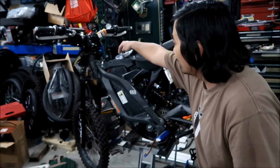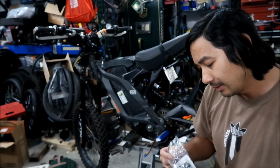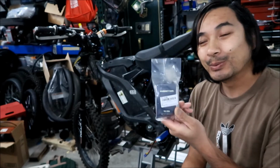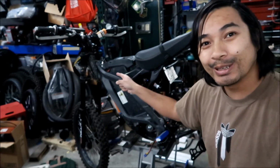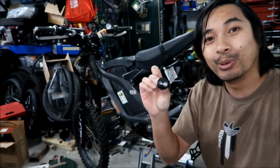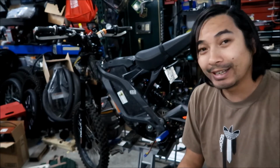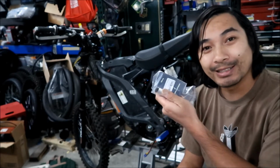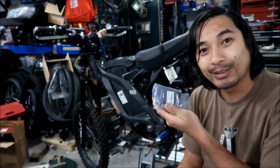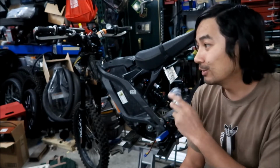I've got a couple of things to help me install this new fork. This is a star nut installer tool. When I installed this fork on this bike, I used a hammer and a bolt to put it in, and I bent one of the bolts putting it in. So I got a proper tool this time. I got it off of Amazon. I'll put a link in the description if you want to know where I bought it. If you want to buy one too, I will be using this when I install the new one.